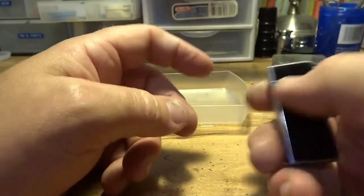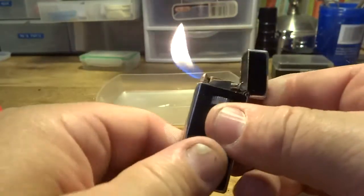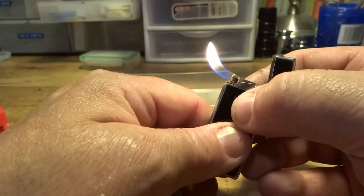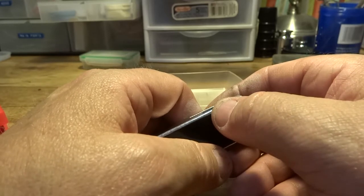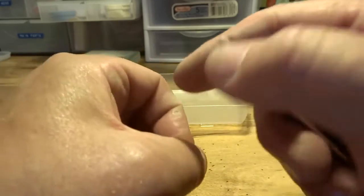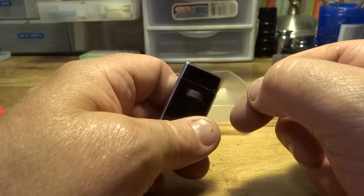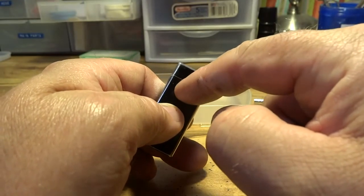All right, you guys, that's pretty simple. There ain't much to it, but if you've never done it before, there's those little tips that you need to know, especially cutting that, like I said, cutting that little seal off. That little stopper seal goes over the little hole in the valve. You're cutting that off flush with the brass piece that stopper's in, and cleaning out those valves and making sure all them holes are unplugged. And make sure that when you put this back on, some of these don't have a screw on, they're just loose.